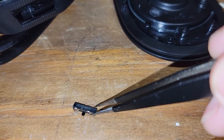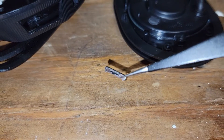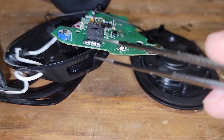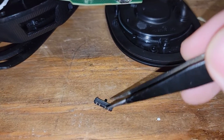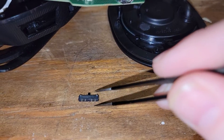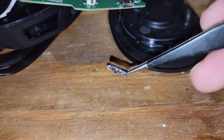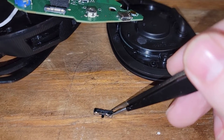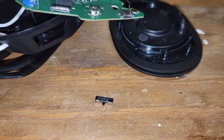Even though I'll rebuild them with a new spring, I think it's worth stating that I just don't believe these switches are robust enough for the type of physical abuse that an on/off switch gets on a device like this. It's kind of amazing that you would lose a headset — not incredibly costly but still setting you back quite a few dollars — simply because of a very cheap switch. So if you're having problems with your RIG 800, it's most likely because of this switch and that spring weakening over repeated use.